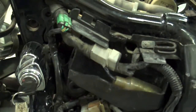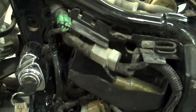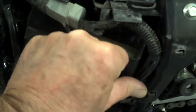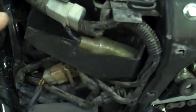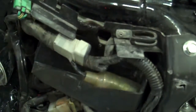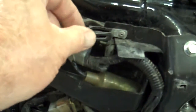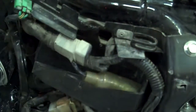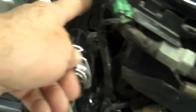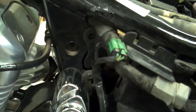Now it's time to do the left side of the bike — basically the same way with just a couple of differences. Here's the ignition key to help orient things. One thing we need to do is make sure the wires are routed around here like this so they fit flat, so when you put the side cover on they won't interfere. I snipped this little area of the side cover off to run my wires up through there and back into the signal lights. You may want to leave this little loop here just to hold those wires in place. Make sure everything is tucked in and out of the way, then remove this screw out of the plastic — it's in the same place as the other side.